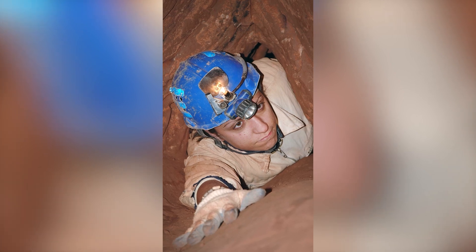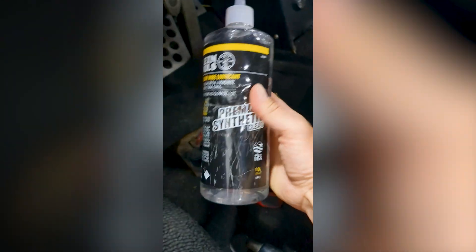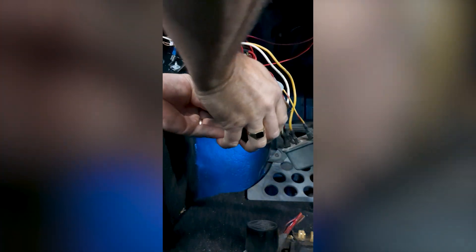I'm going to give you guys a little tech tip on installing the relays into the recess on the panels, and that goes for any Porsche owner if you're using the round relays. I'm down here — everyone's favorite place in a car is under the steering wheel and under the dash. You've got to be a bit of a contortionist and make sure your patience level is on maximum. Here is how I go about installing the relays into the holes: you're going to buy some lubricant at Home Depot or somewhere else. Put a dab of that on the backside of the little nipple where it's going to go through that hole. Then take a stubby screwdriver — there's a hole inside the relay socket — put the stubby screwdriver through and push.